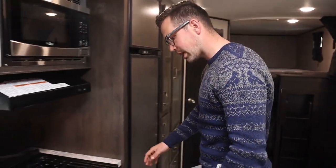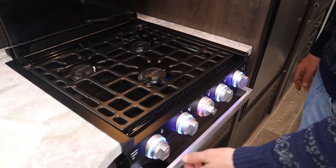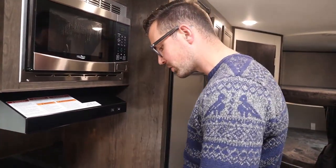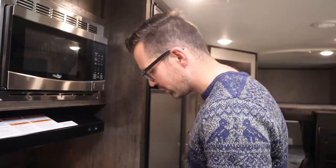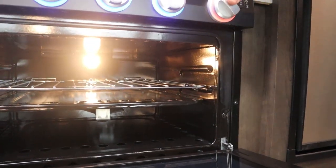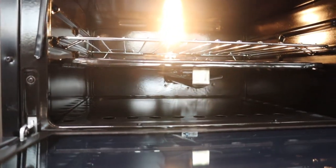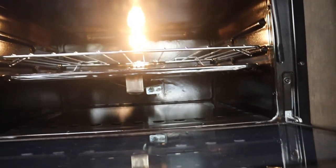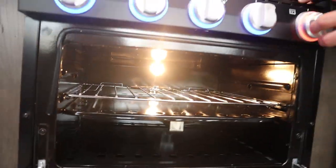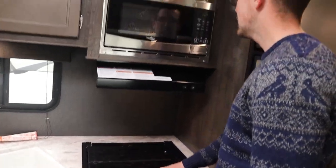Before lighting your furnace, water heater, fridge, or anything, you should always light your stove top first. Turn the burner knob to flame — the red light shows up — and spark it. If you try to light the fridge or furnace first it won't work because the gas isn't purged to them yet. Once you've lit a burner, feel free to light the fridge or furnace. For the oven: switch to oven position, turn to flame, hold the button in, spark it, and continue holding the button while turning to your desired temperature. Don't cook on the glass backsplash.